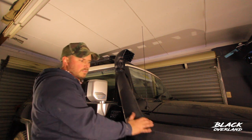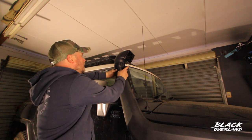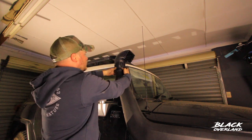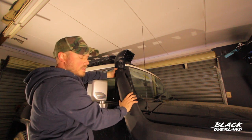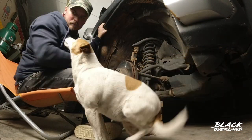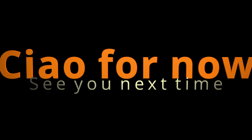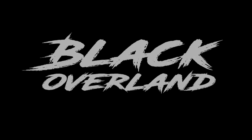The last thing to go back on after you've mounted it to the fender is the intake ducting. This can swivel around, so if you're in very dusty areas you can reverse it, but I prefer having it facing forward. You just need to tighten this clamp, then put the fender flares and wheel arch liners back on, the wheel back on, and that's pretty much it. We'll see you next time.